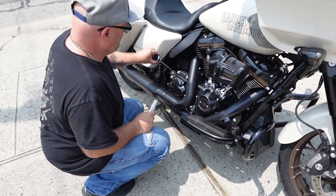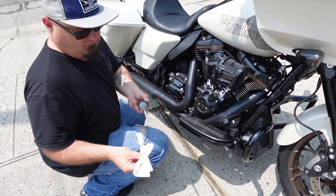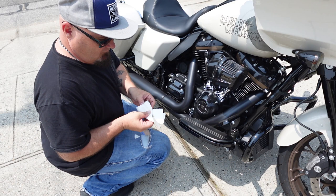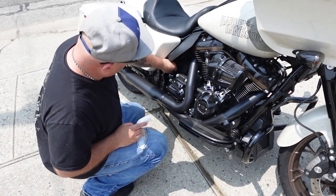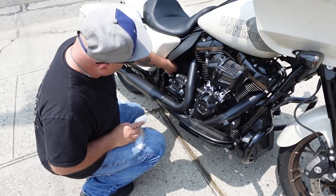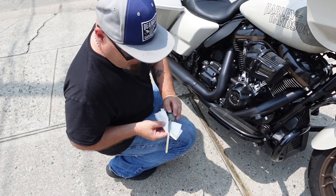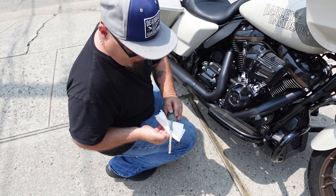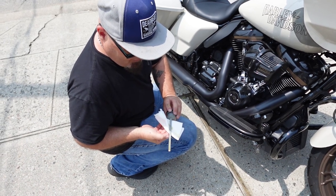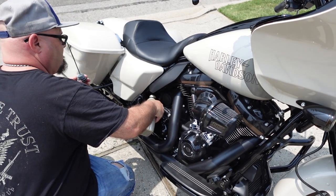Checking the oil, took a quick ride. And was it close to what, 5 quarts? 4.75. And we put in 4, right? A little low? It says a little bit low, just like you see this spot right here? It says full hot on Jiffy stand. So I'm gonna bring it up to where my nail is. All right, so put in one more quart.